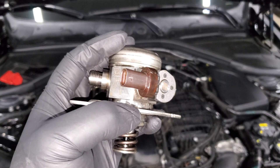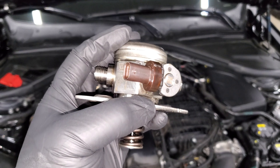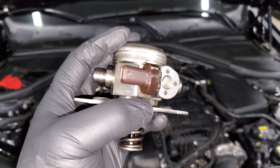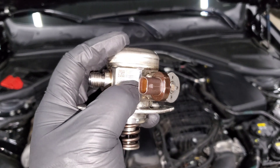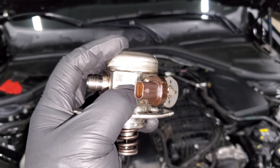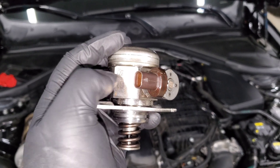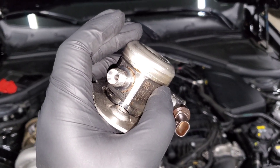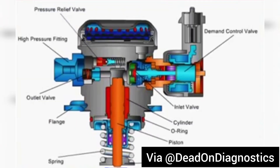What I said in a previous video is that this sensor is just monitoring fuel flow — really, it's not just monitoring fuel flow, it's controlling fuel flow. This sensor is actually controlling another piston inside the fuel pump, either constricting or freeing up the amount of fuel that can flow from the inlet to the outlet, which controls how much fuel is actually getting into the fuel rail.